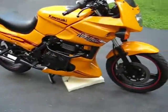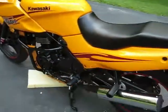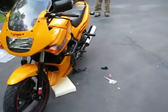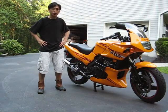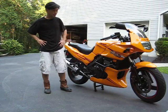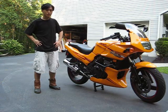The fairing's back on. We can see here, this is what the engine bar looks like. From the back, this is how much clearance you have. One of the things I like about the black is that it just kind of blends right into the bike. Instead of a frame slider where I'd have to cut into the fairing, this kind of just protects the lower fairing as well as the engine. Despite the fact that the engine bars didn't fit perfectly like I had hoped, I don't think it really mattered in the end. Steve and I just tried lifting the entire bike by the engine bars and you can easily do that — it's strong as hell. It's covered by the fairings, so the part that doesn't latch in perfectly is covered. And I'm happy because I didn't have to drill into my fairing.